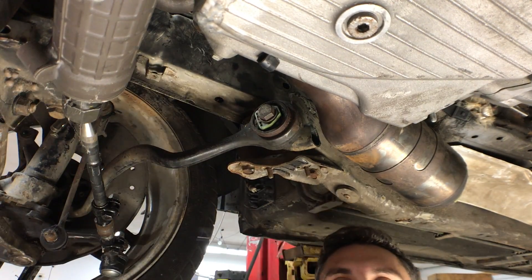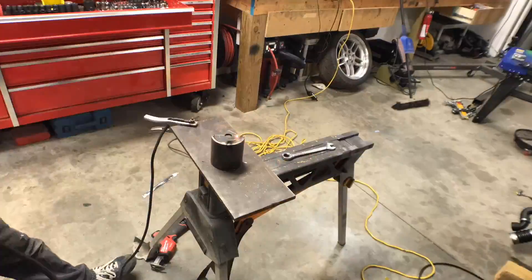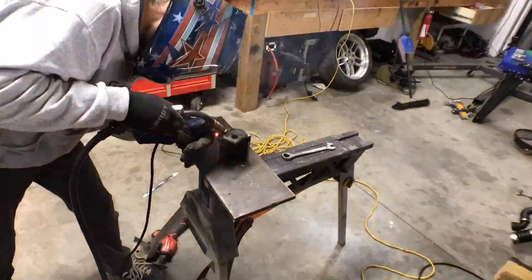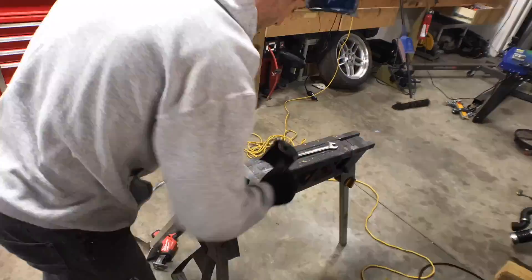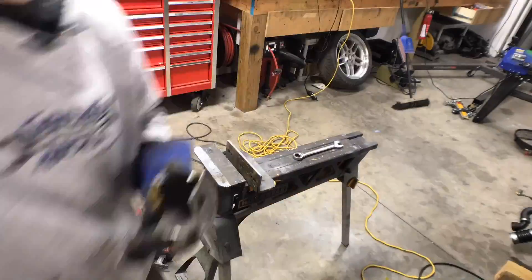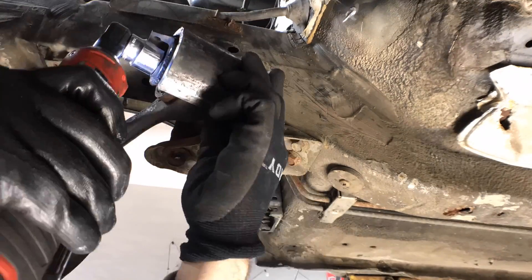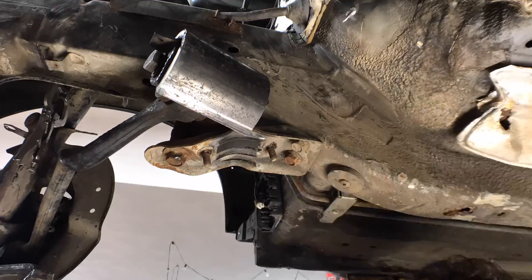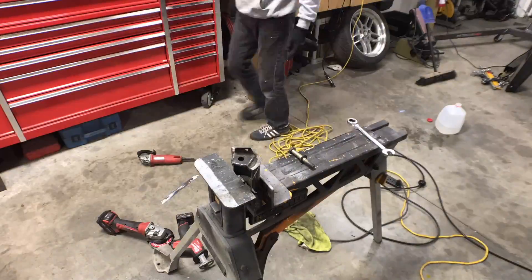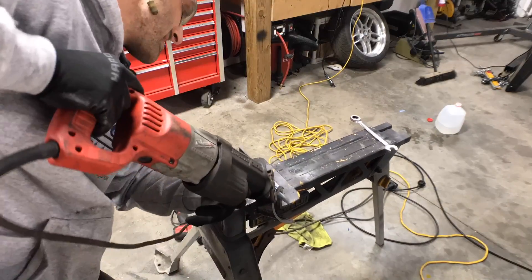This is what I plan on doing with the upper control arm — a semi-circular piece of three-inch tubing with an end cap. It's going to end up getting welded in just like this, sitting on the outside. I want to make sure there are no fitment issues with the header, and there are none. This is going to end up getting test-fitted a number of times — we'll fit it, make some minor adjustments, make some cuts, grind things away to get it to fit perfectly, and then weld it in. We're also going to be welding in additional bracketry along the frame rail for extra strength. For purposes of the video, we're just doing this one side.